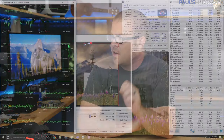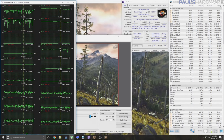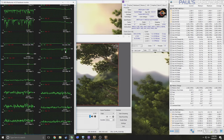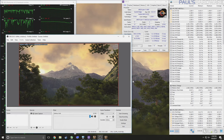You can get a little bit more out of your graphics card with a four-core Intel processor like a 7700K, which has better IPC performance. However, if you're going with a six-core Ryzen and considering gaming and streaming at the same time, that has been objectively shown to have better performance — a smoother experience not just for gaming but also for the stream output. Gamers Nexus actually did a great test on that recently, so I'll post a link in the comments. For this final test I was running Unigine Valley as my game, and using OBS to capture it and write it locally to the disk.